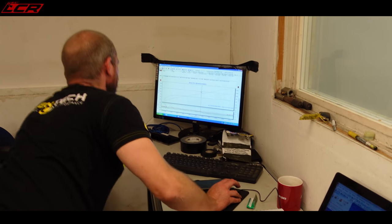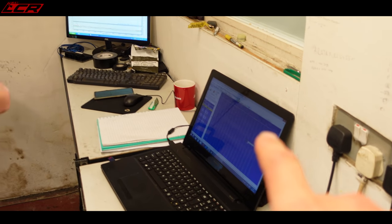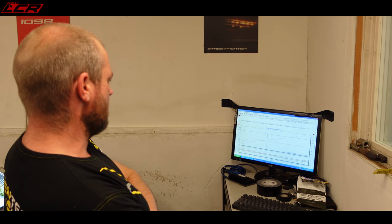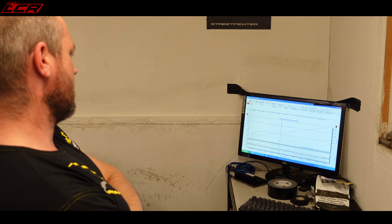It's enough, isn't it? What's your process then, Chris? You look at the air fuel mixture and then you edit it directly on there, looking at how rich or lean it is. Yeah, that's it. So generally, for one point of a change in air fuel, you're looking at about 8 to 10% change in the map to get it to shift.